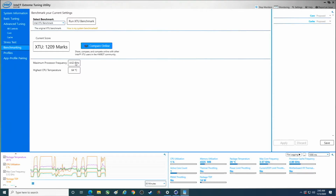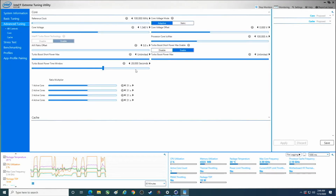And our CPU got hotter, but this is worse. So now, what is the problem here? Most likely, I don't see for this motherboard the ability to put an extra 1x4 CPU power connector on it. And that may be, you know, some of the issues.